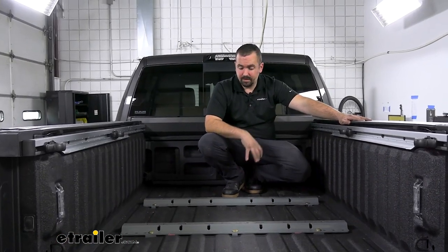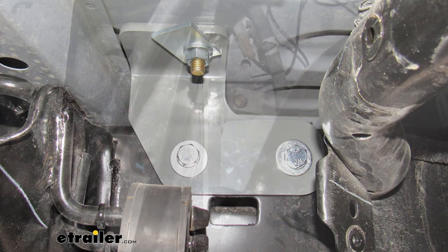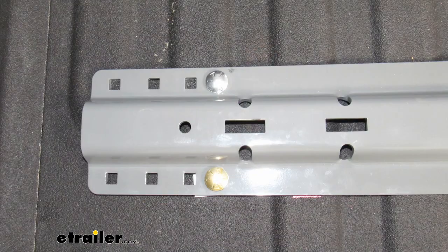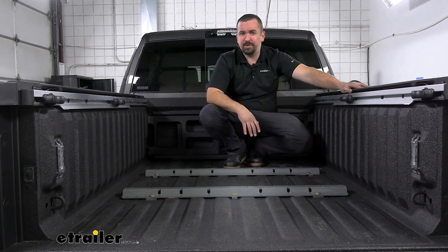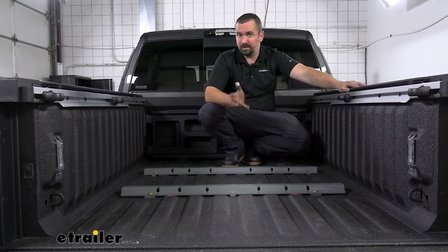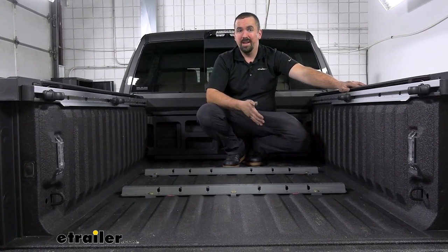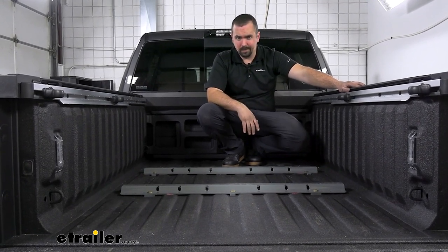As far as installation goes, this is a pretty easy kit to do. Your chassis is already set up for these custom fit brackets and the kit is designed to work directly with your truck, so there's no drilling required to mount the brackets to the frame. The only drilling required is to make holes for your carriage bolts. It can be done in about three hours, in your garage or driveway. It's B&W, which speaks volumes about their quality — hardware, powder coating, everything is very high quality.